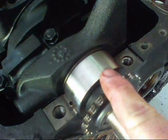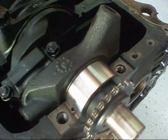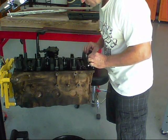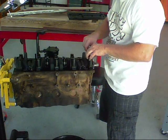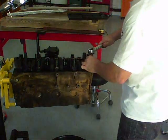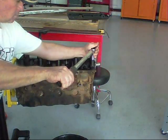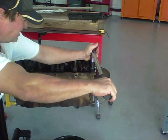There's a little piece of Plastigage laying diagonal across the bearing journal there. What I'm going to do is put my main cap on there, torque it down to 80 pounds, and we'll measure from there. Okay, we've got it torqued.